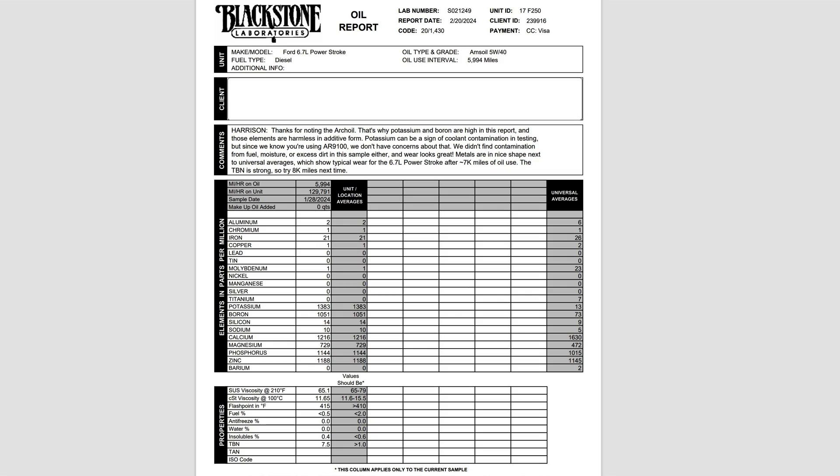We're back. I got my oil test results from Blackstone Labs so let's walk through those right now. One thing I want to explain at the outset — TBN stands for total base number, and that's the amount of detergents and dispersants left in your oil. They function to keep your engine clean, remove varnishes and sludge buildup, and basically prolong the life of the oil, because oil's two main functions are to lubricate the engine and keep it clean.